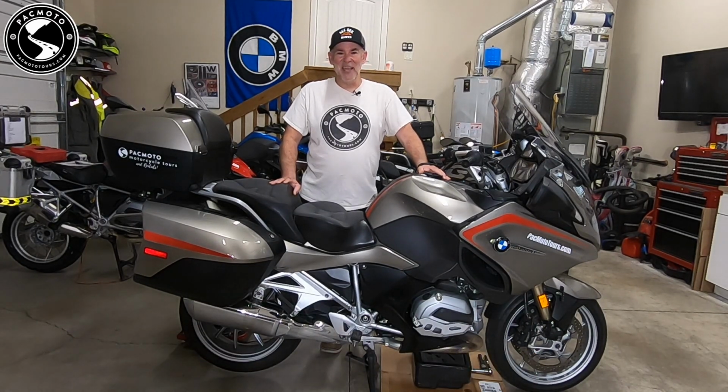Okay, as I said, we're going to do a 12,000 mile service on this water-cooled R1200RT. This will be broken up into 3 videos. The first video will be the oil change and final drive fluid change. The second video will be replacing the spark plugs and doing a valve clearance check. And the third video will be replacing the air filter and resetting the service indicator.